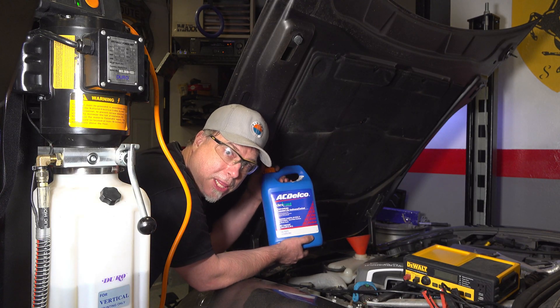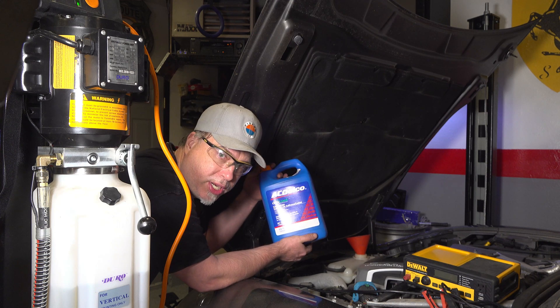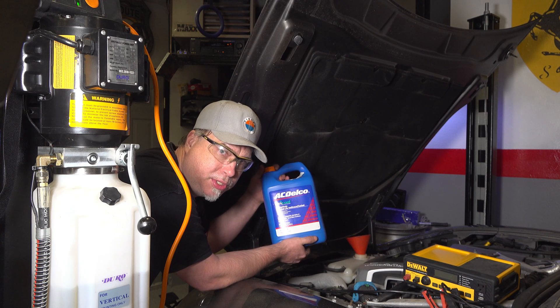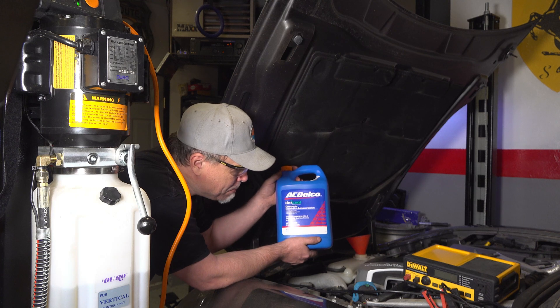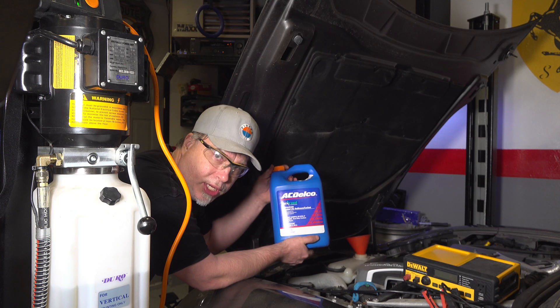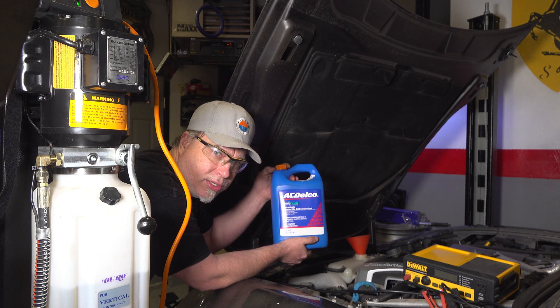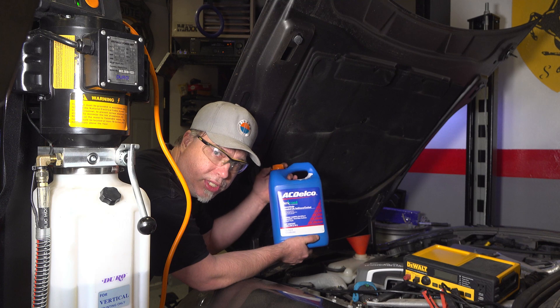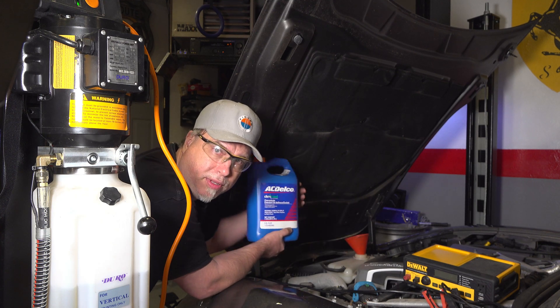You've got to remember to fill that low-temperature coolant back up. This is a 2-liter turbocharged engine from the Saturn Sky or Pontiac Solstice, so I guess I have two of these engines now. They run Dex-Cool, and I can see that the stuff I got out of it was kind of a pink color, so I'm pretty sure that's what it is. I buy a concentrate and do it with distilled water — reservoir is right here. Fill her up.